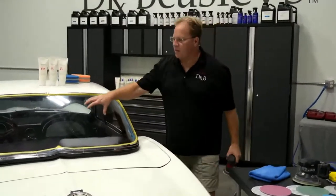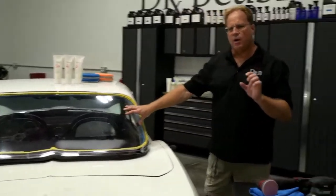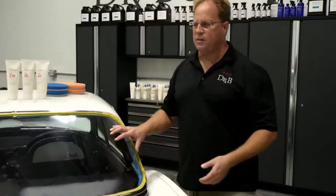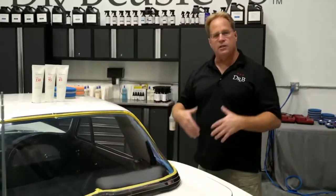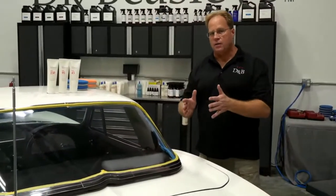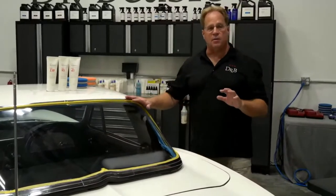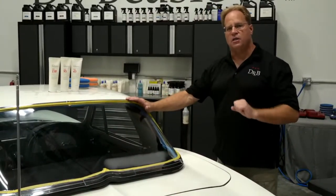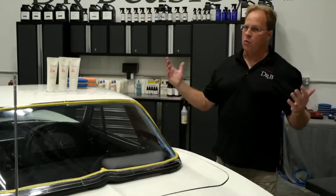So this is Plexiglass. I just want to talk a little bit about that. Plexiglass is a trademark name for a type of plastic. It's very soft. It was used a lot in the 50s and the 60s. As technology changed, just like the phone you buy today is 10 times better than the phone you bought last week, plastic has changed, and plastic became harder, so it resists oxidation better. The problem with it becoming harder is that it's really hard to work on.